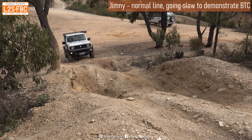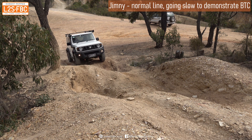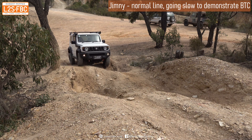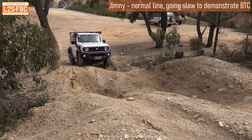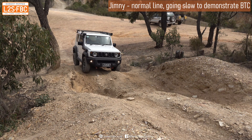We're going to do that demonstration again. At this point we're just demonstrating how the traction systems work — we're not trying to show how to drive a four-wheel drive effectively off-road. So the driver is just going to edge forward. You can see we've got diagonal wheels with little weight and therefore little grip, and as we increase the revs you can see those wheels being braked and then the vehicle moves forwards.